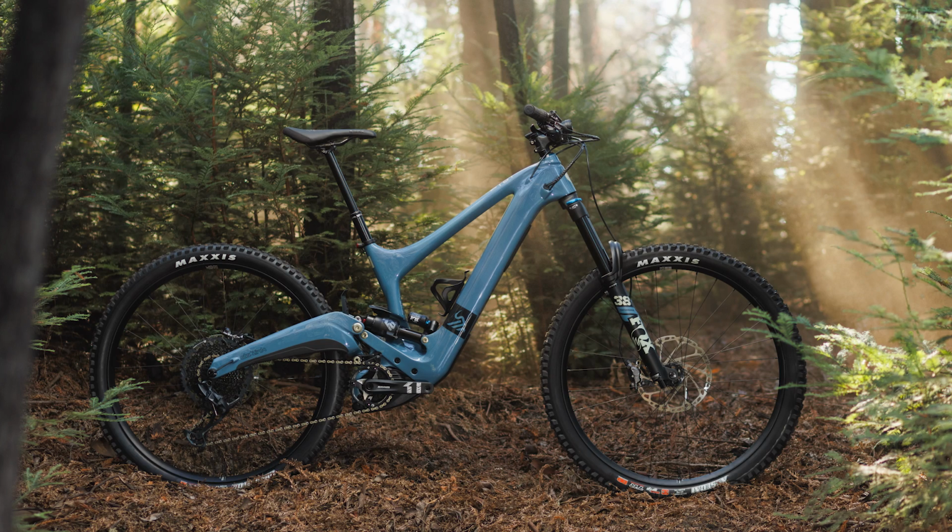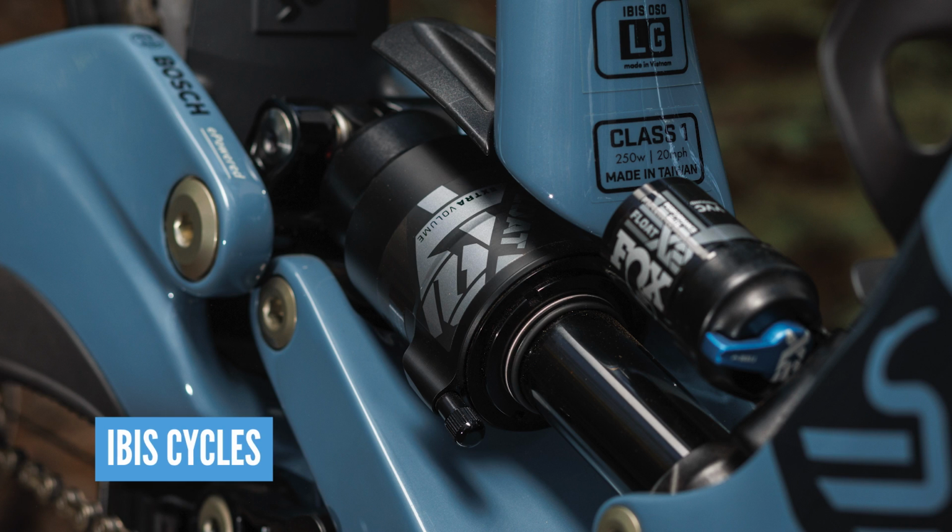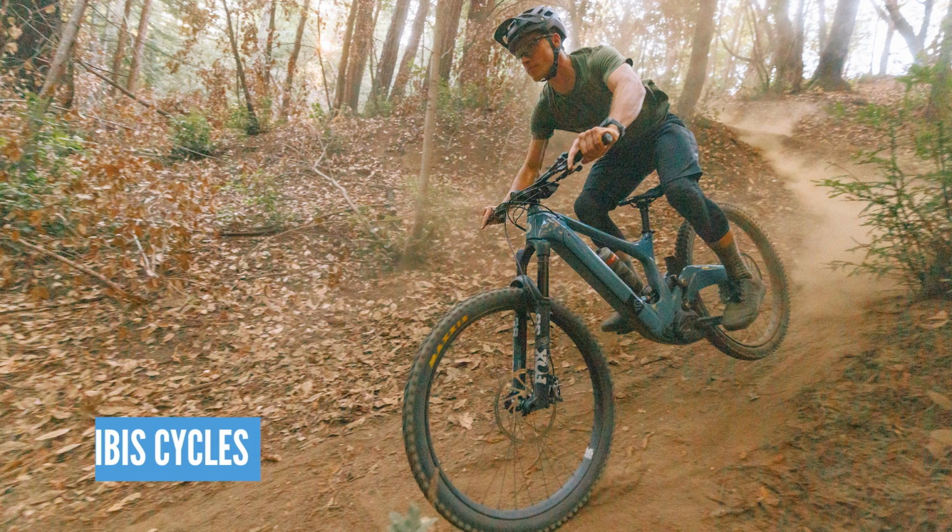Yeah, it's a great looking bike, full carbon frame. So this bike, 155mm rear wheel travel in its stock form. It's got a 170 fork up front. But it can be swapped around if you change that shock out to a bigger travel bike, 170mm travel, and the forks you can take up to a 190mm travel fork. Proper bruiser of a bike, isn't it?